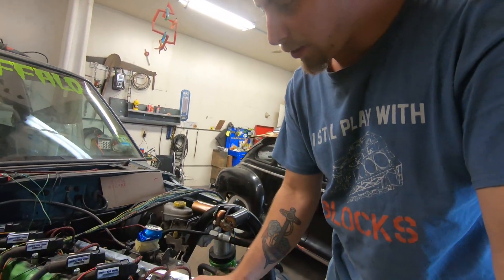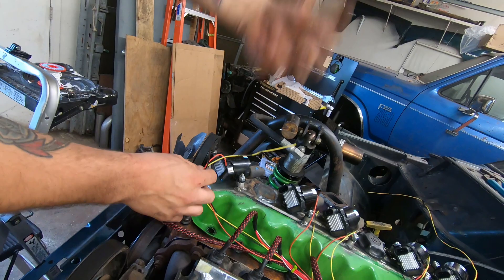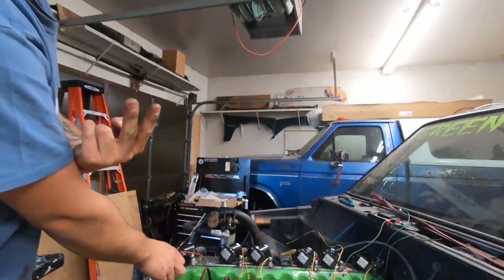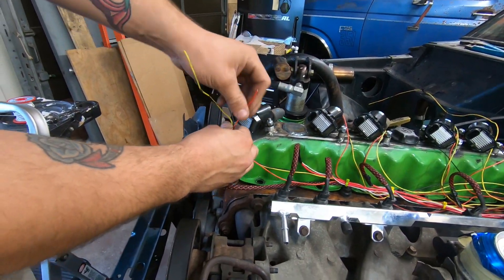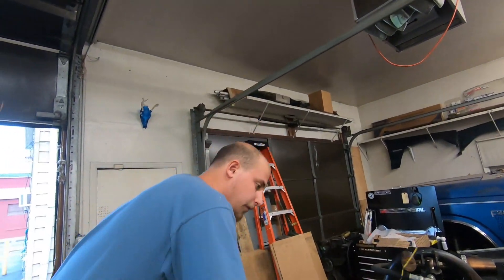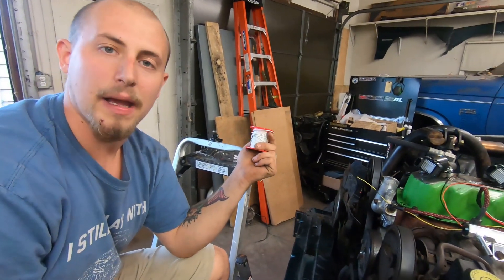We're back. We've got three out of four wires run for our coils. One of these is a sensor ground from the Mega Squirt. The yellows are the spark signals — spark A, spark E, spark C, spark F, spark B, and spark D. There are obviously two extra off the MS3X because it has eight spark outputs but we're only using six, so the other two are getting tied away. We've got the yellow down, the black down, and the red going into our Painless fuse box for switched ignition. That's three of the four pins. The last pin uses white wire — that's the ground to the block itself.